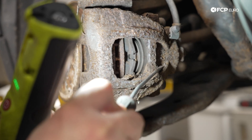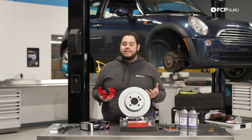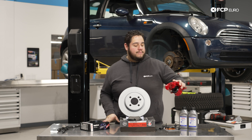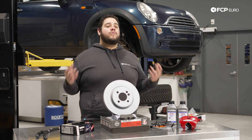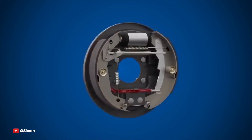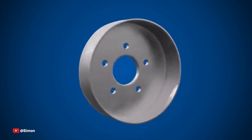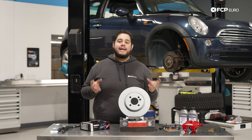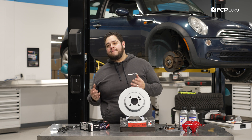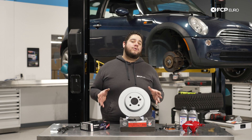Keeping these not only clean when you wash your vehicle, but keeping an eye on them every time you do a brake job — pushing your pistons back in properly and servicing the brakes properly in general — can go a long way in enhancing the life of your brake calipers. Worth noting, even though it's not pictured here, are vehicles equipped with drum brakes. Those have brake shoes inside — similar to a pad in a curved shape — that sit inside a brake drum. You have a wheel cylinder, which much like a brake caliper has rubber bits inside that expand and over time can fail, causing a leak and brake failure. Those need the same service and attention, even though they're a little more archaic.